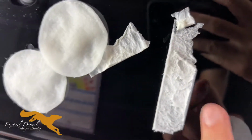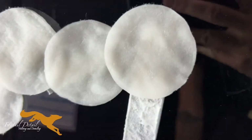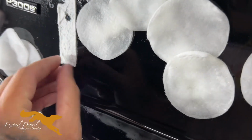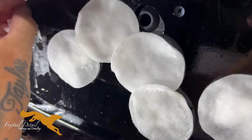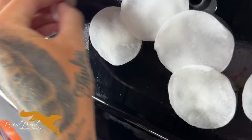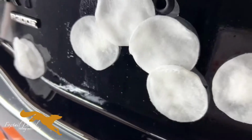Top tip for anybody struggling to get the number plate sticky off: just cotton wool pads soaked in tar and glue remover. Stick them on, leave them for a minute, and eventually they peel off. And then the glue will just wipe off with a makeup pad. So much easier than scraping them.